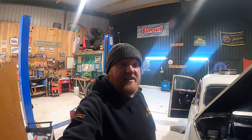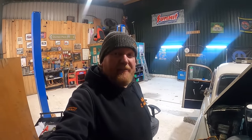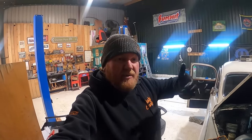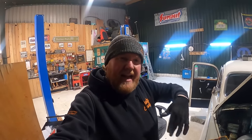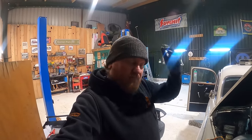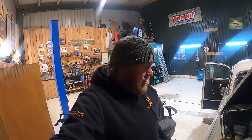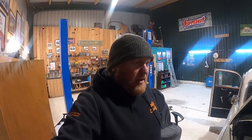So it's like 6 million o'clock, and yeah, I've been having problems trying to time it. As I was timing it, I was noticing that every now and then it'd miss, and then it started to run a bit rougher, and then it just got really bad, and I was like, oh my god, what's going on? The spark was just disappearing. So I pulled the dizzy cap off, and the points were burning up.